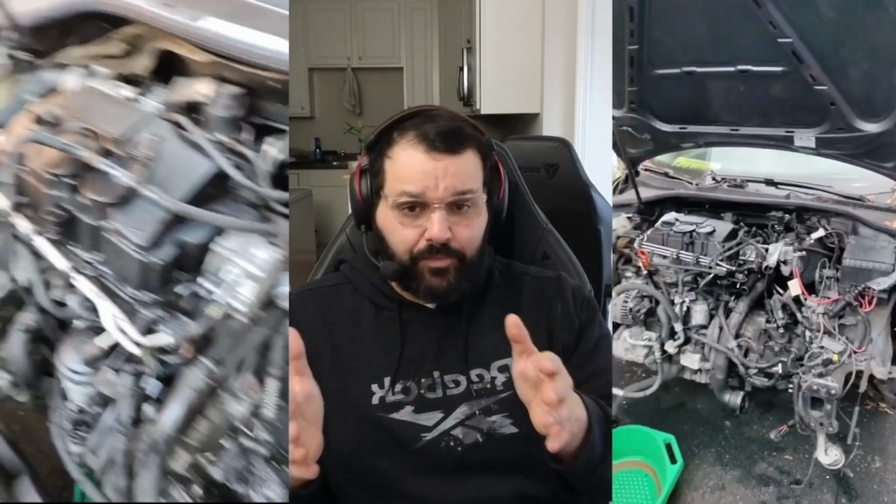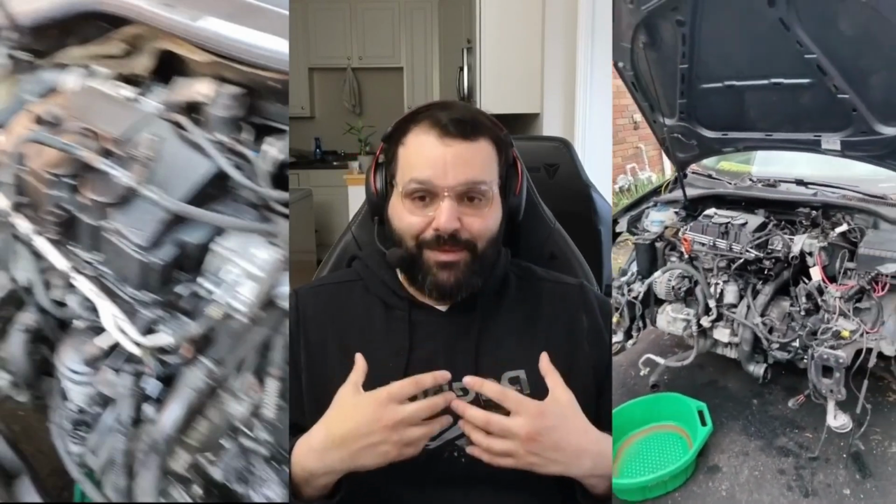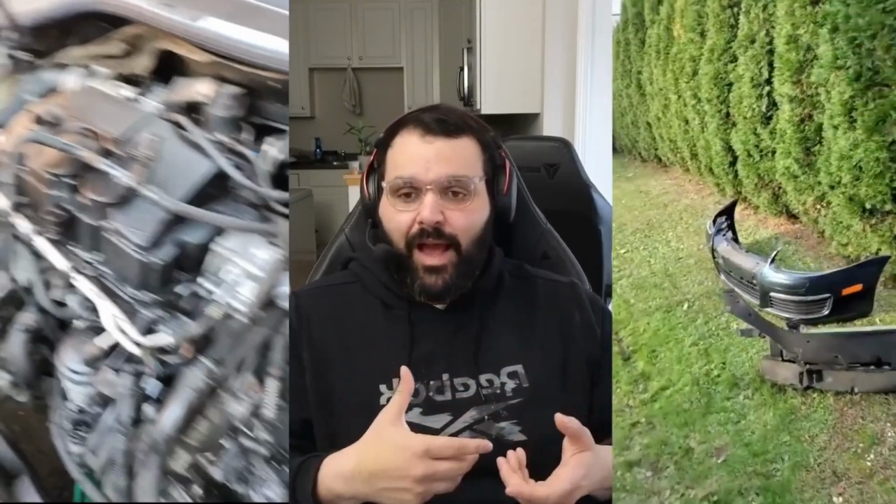Now, also notice I have the car on jack stands, right? That's really important. And something I didn't talk about earlier. One of the things to identify, you got to remove the axles. One of the big mistakes I made, and when I say mistake, I mean this cost me so much time, where there was a much easier way to do it, is I actually opted to remove the entire axle out of the spindle, out of the hub, whatever, and pull that out of the transmission. When what I really should have done, right, was just unbolt the axles.